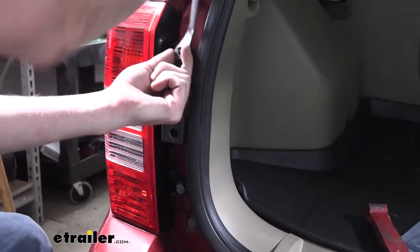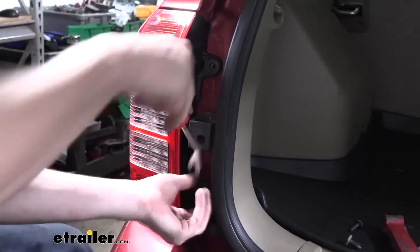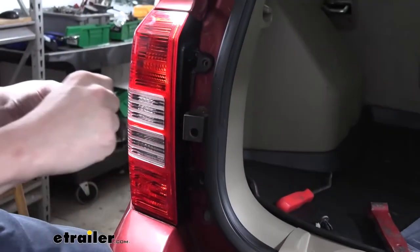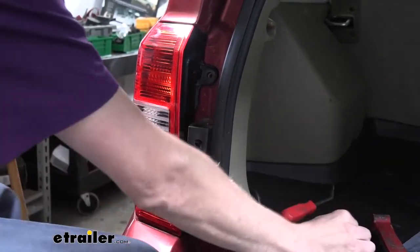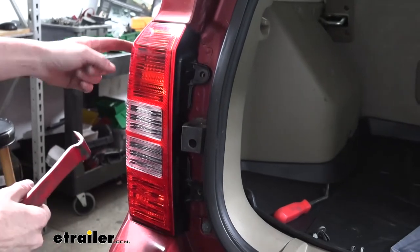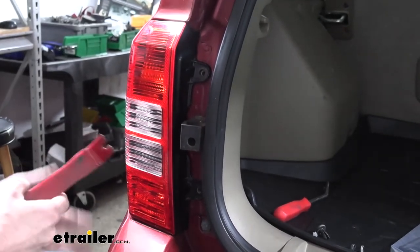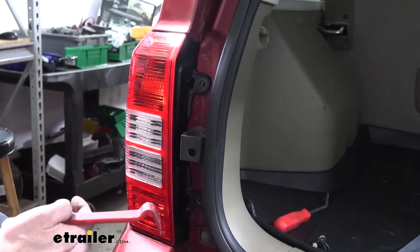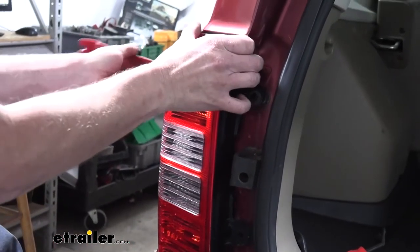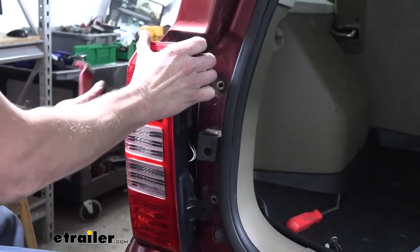After you remove the center tab, we can slide the entire piece out of there. We're going to do the same thing here on the bottom one. If they come out in two pieces like that, it's no big deal — you just simply take them and slide them back together. Now the whole assembly is ready to come out, but this is actually more difficult than it looks. There are a couple of pins pushed in here and here and you just need to pull straight rearward to remove it. The plastic that these taillights are made of is extremely hard and very brittle, so it tends to crack fairly easily. We're going to use a plastic trim panel tool and gently work it in, rocking it down the seam until it pops out of there.